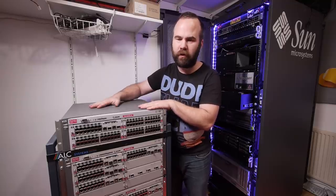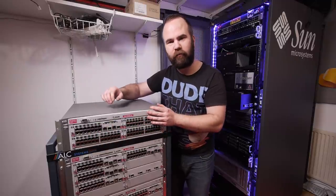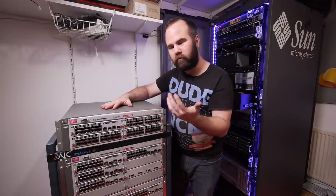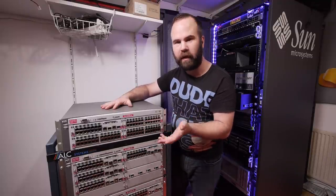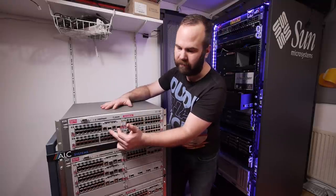The fifth switch for the LAN is only a 4-bay chassis — this is the 5304 XL. I bought this on eBay and this is a configuration that could be used by a company with three 24-port 10/100 blades, one gigabit blade, and also two SFP ports.